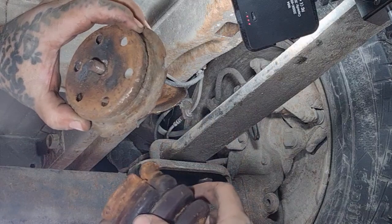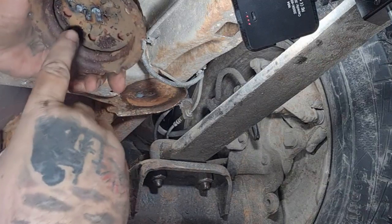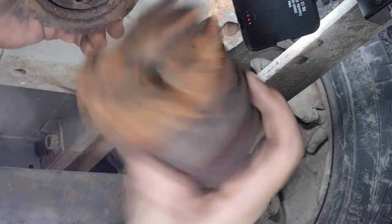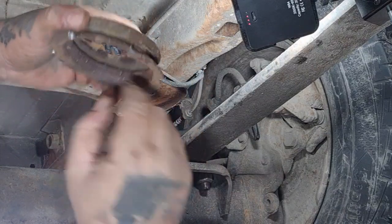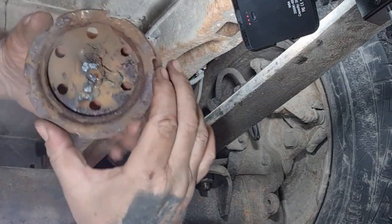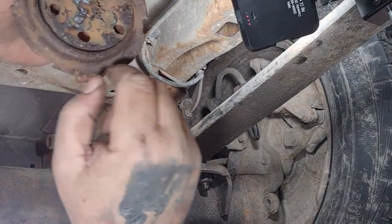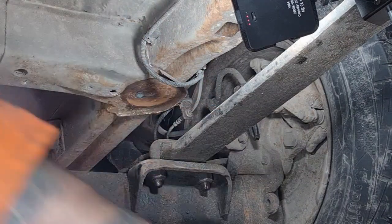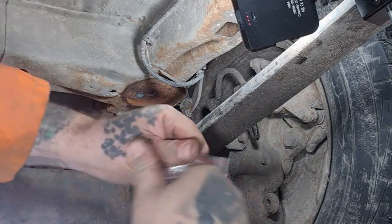whoever designed this thing wants shooting, because that bolt has got a round head, it doesn't have a hex head. So what's happened is, that is then just tacked to this plate before that's inserted. And what's happened is that the tack welds are broke, so that was spinning, but the threads were staying still. So what I've done is, very crudely and very badly, and I could weld a lot better than that, but I can't get in to clean it. So I've just chucked a load of weld at it, you know, as you do, and then just beat it until it came off. It's off. So, yeah, happy days. Well, for that bit, got other side to do.